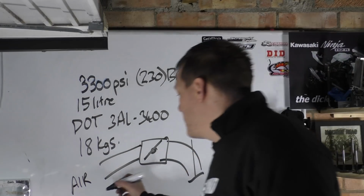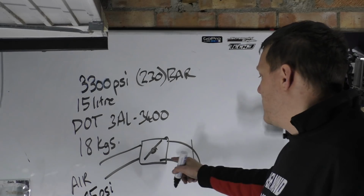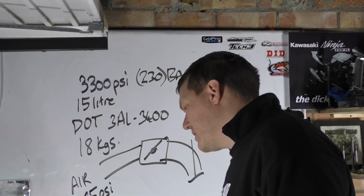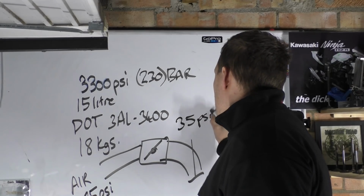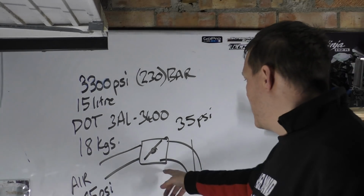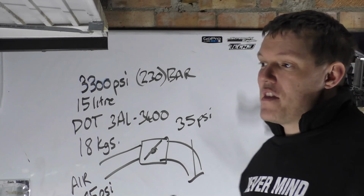because if atmospheric outside is just, say, let's just say 15 PSI for simplicity, not that 14.5 nonsense, you're trying to boost this by putting in, I can't remember what, it did say that it could put in like 35 PSI or something. If you just didn't have this valve and just tried to push air into your intake, it's going to blow back out. So they have to have a valve system that shuts off your intake, and then they basically use the bottles